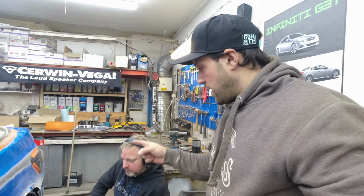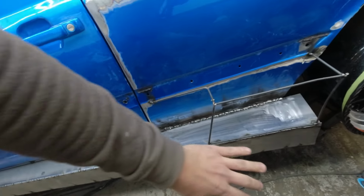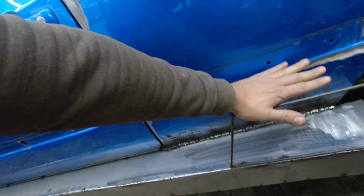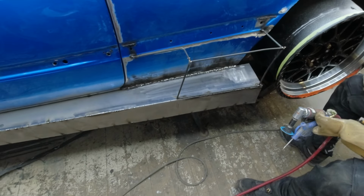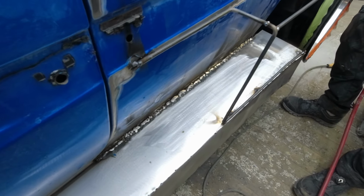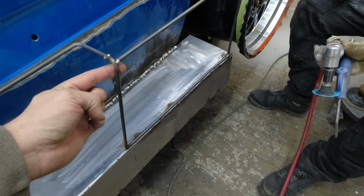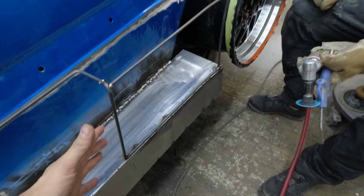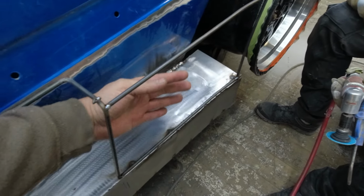So Martin is prepping for that. I'm going to do the side panels for the box. It's going to be one plate on the inside and one on the outside, because I don't want people looking into this and saying that you can see the rods, the skeleton. So it's going to be boxed in, smooth and nice all over the place, taking it step by step. And then the hard part comes, fusing in the taillights and making the big arch in the back.